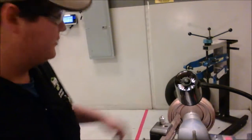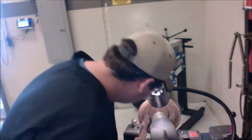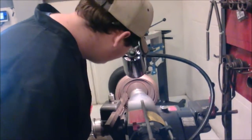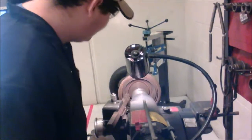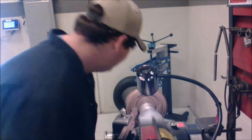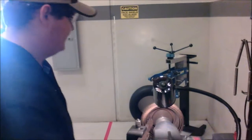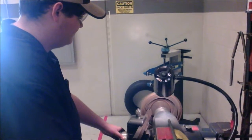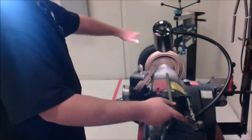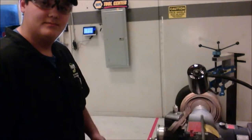Right there we can confirm it's scratching — making the scratch noise and you can see the line is creating. It's cutting. Now we're going to bring it out and cut the edge of the drum. We've cleared the edge; now we're going to go all the way back in. We've hit the back — now we set it, make sure it's cutting, then switch it so it's going to start moving out, cutting all the way. Now it's moving on its own, finishing the cut for us.